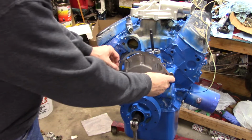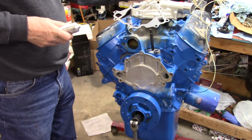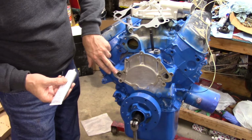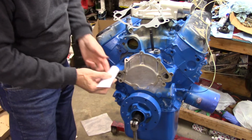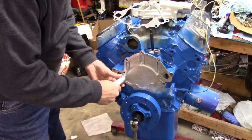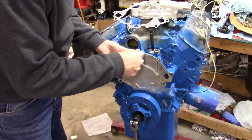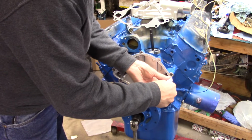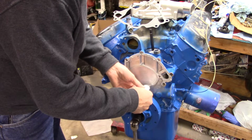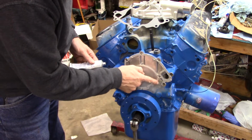Anyway, so we're going to give this a try, and I'm going to go ahead and just make it work. I don't know what else to do. Now, I'm going to tell you this. The furnace is going to kick on here in a second. I'm going to reuse the old bolts, and the reason I'm using the old bolts is because I'm putting just a little bit on this to help seal this up. Maybe. Well, how much is in this tube? Nothing? I like to use just a little bit of this gasket maker on here. It actually holds the gasket while I'm doing it, but the biggest thing here is I don't know where this Chinese piece of equipment was made. So the odds of it leaking are pretty good. Anyway, I really don't even need it down here because, like I said, there's a weep hole down here, but I just want the gasket to sit still.